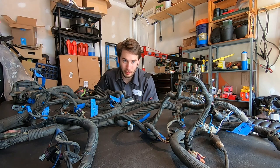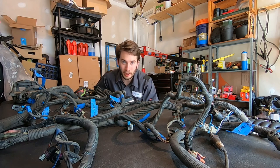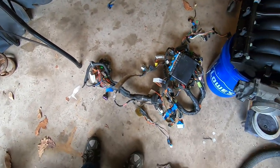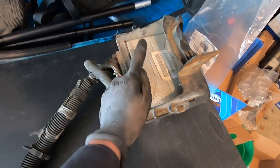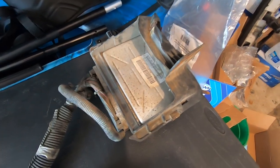This is going to be shot in quite a few parts and it's going to be pretty long. First we're going to start with the harnesses from the donor vehicle and what I'm going to do to them. Then as we get the engine inside the car, we'll set the lengths correctly and route things how we want to, making sure it looks nice and tidy. This is the PCM, or powertrain control module, out of the Yukon. It controls the engine, transmission, and even the air conditioning.